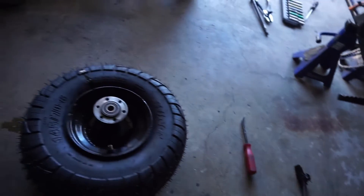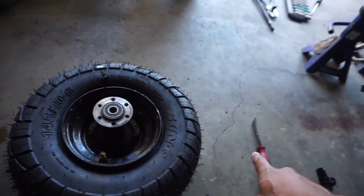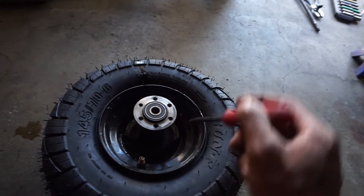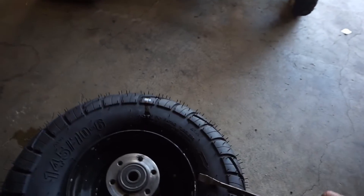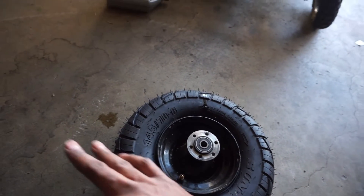I finally got it — I had to go inside and look it up on YouTube to see how others did it, because tires are just one of my weaknesses. I took a little break, checked YouTube, and figured it out. Leverage is your friend. Get one side on, put your knee on it to keep it compressed, then use a flathead to work the other side on. Scoot your leg over and keep compressing the part you've already got on. Let's see if this thing holds air.